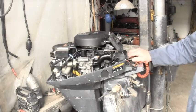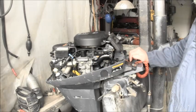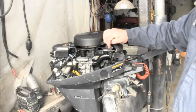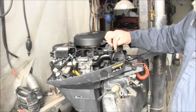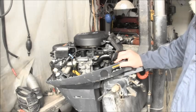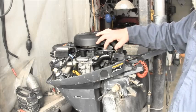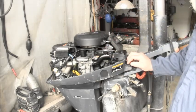And if you watch right here, here's the gooseneck. When I pull the choke, it closes it off. When I open the choke, it opens it up. You can see I drilled a hole through the top of the gooseneck to put this. I put a nut on that side, a nut on that side, then a washer. And I got this spring because even though I've got it a little bit counter offset with a little bit of weight right here, I was thinking that when this thing's running wide open throttle, it might suck that back in, and I didn't want that. I've got plenty of room to adjust this if I want to open it more, but that's actually a lot bigger than it looks. There's going to be a lot of air sucking down through there.